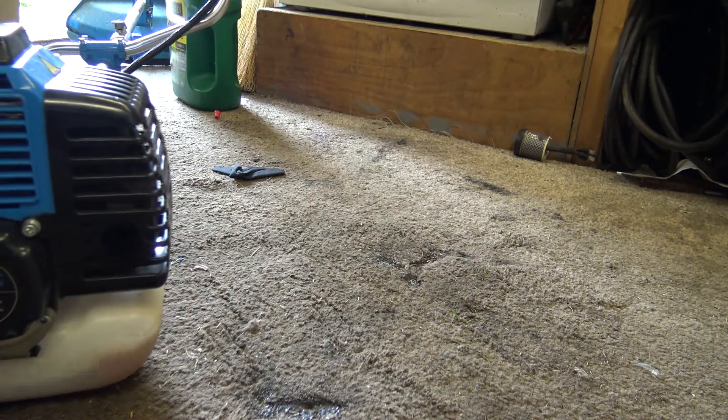It gave a little cough — it took a while because this strimmer's been sitting upside down since I primed it, but it coughed once. Once it coughs, put the choke down to the run position and with any luck it should start up. It conked out because it's cold. For a brand new engine, I think what this person is doing wrong is trying to get it to run on the choke. It'll fire once or twice on the choke then conk out — put it to run and start it up.